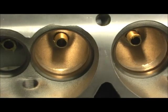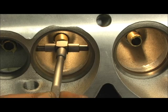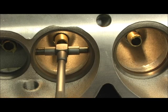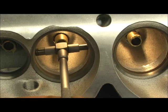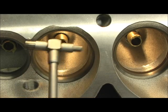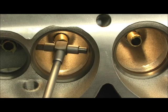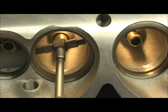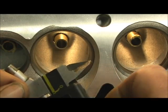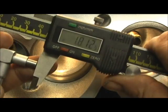To demonstrate this, I'm going to take a snap gauge and hit right here. That's going to be our basic bowl size — this is going to be probably about an inch from the seat, right around in that area. Now look at this. This is laying right there on top of it. I have to move the snap and go in here to reposition it to get it. If we go in here and measure this, what we're ending up with is a 1.812 bowl.